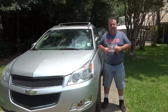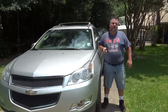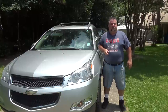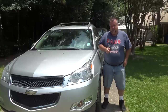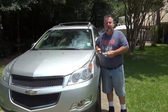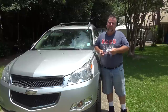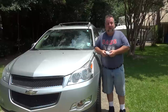Be sure to check your car and make sure that's actually possible. After 2010, in 2011, GM made it way more difficult and did not give the consumer the option to program new remotes — you have to go to the dealer. It's pretty pricey for the remotes and also to program them. You can purchase these remotes from outside vendors, which I did.